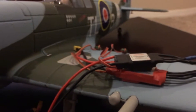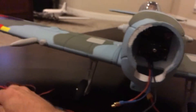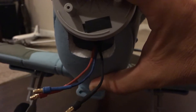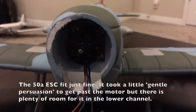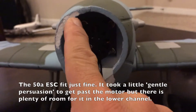I'm just going to upgrade the ESC and put everything back together. I've already made my cut — you can see when I put the spinner on it'll cover the opening and I've got an air scoop that'll be force-fed from the prop wash right into the airplane. When I take the cover off, that's where the ESC sits, so the airflow goes right down into that ESC compartment. I also need to put an exit hole in the back, otherwise it's like dragging an umbrella through water.